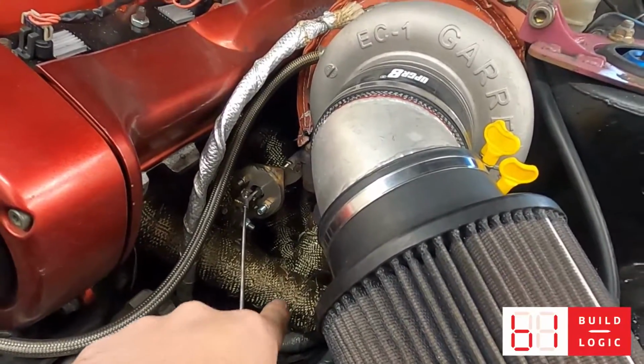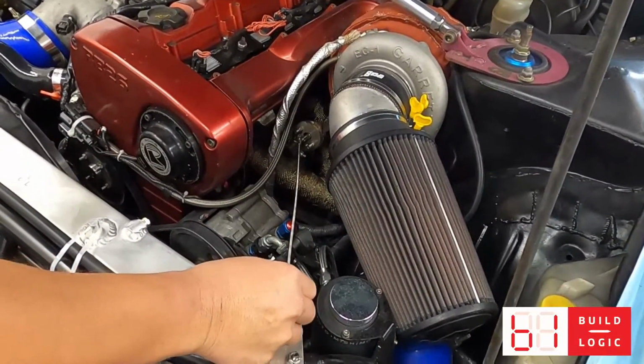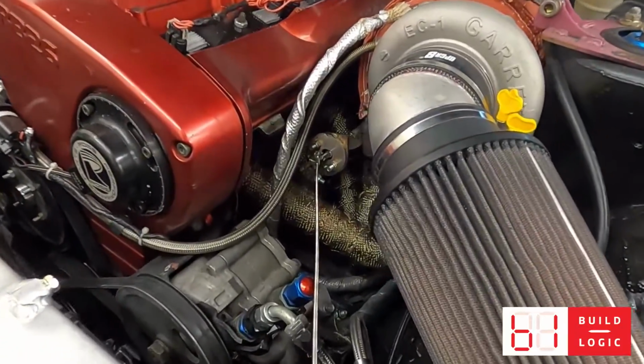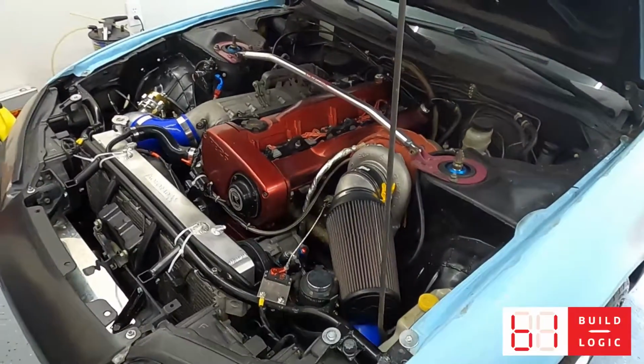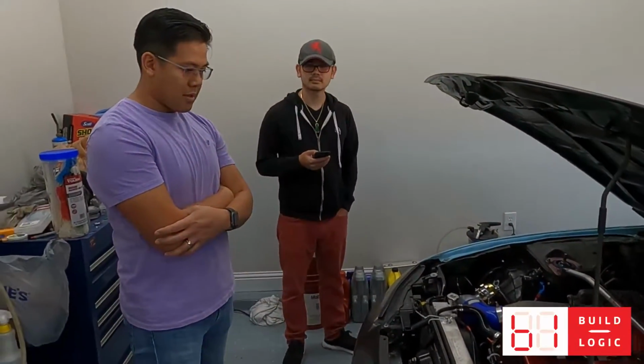Down there, this little rod that's getting bumped around is just a quick spool valve, a Sound Performance quick spool unit down in there. I didn't like having a boost actuator on it because it choked the engine when you're off boost all the time. So that was just my temporary fix to try to keep the valve open, and control it with the ECU.